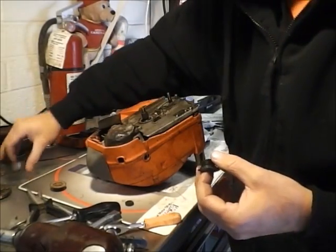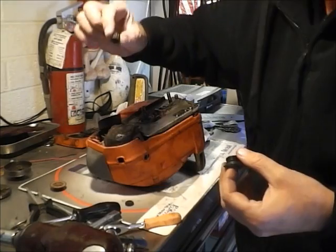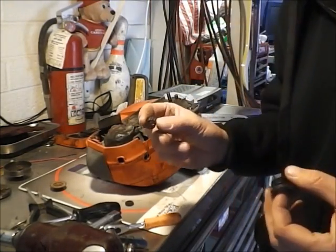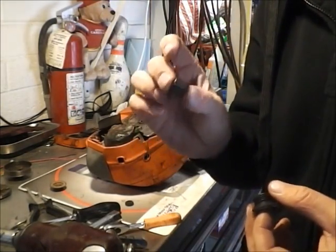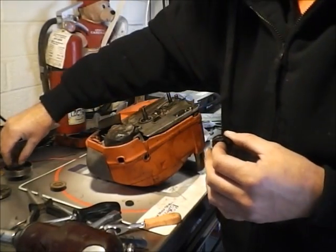Once you take the drum out, inspect it; all looks good. Go ahead and take the bearing out. I like to use high temp grease when I reassemble this. Go ahead and pack a little grease in there. Go ahead and put it back in.